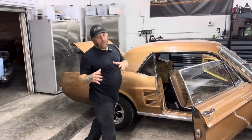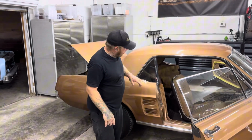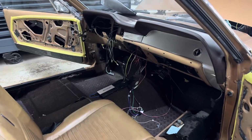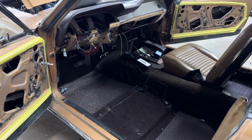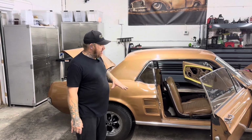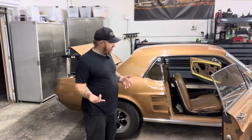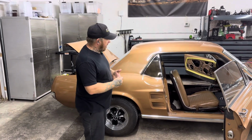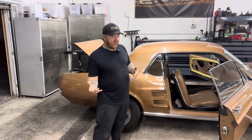Okay, most of the reason why I prefer to do as much electrical install at one time as possible is how much you take it apart. Here we have the passenger seat out, the rear seat out, door panels, and interior quarter panels, and that's just to get to the basic wiring harness. Now ironically, that's about the same time you have access to your speaker locations, wiring routing for that, anything for the fuel injection, and lighting. Changing your lighting is a good time as well.